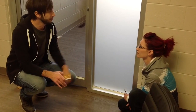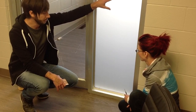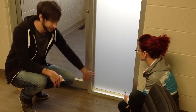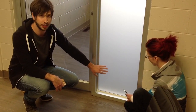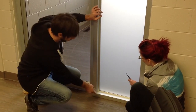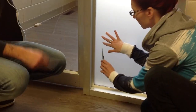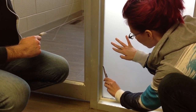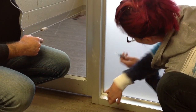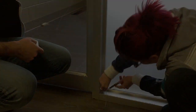Once you have dried the whole thing, you can even let it dry for about an hour or so. The next step: if you have any edges that are overlapping or the vinyl is kind of going over a bit, you will want to trim it with a sharp knife or a surgical blade. Basically all you will do is get in the corner and run your blade right along the edge — just trim that little bit off. This works best when it is dry. Then you should be able to just peel that excess vinyl off.